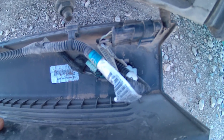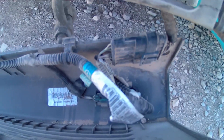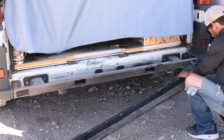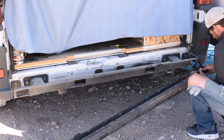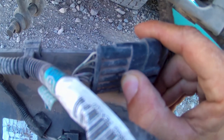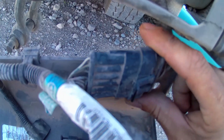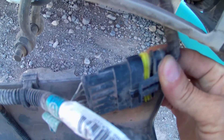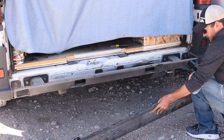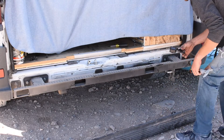Your sonar will just connect by this one little connection, and all you're going to need to do — to release it, you just lift the tab and give it a little wiggle, and that's it. I'm going to make sure that's disconnected and we'll just set this to the side for now.